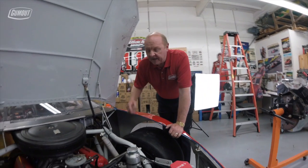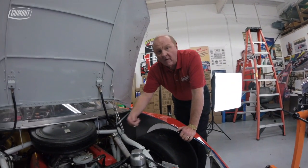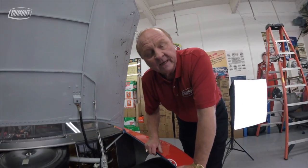What's the advantage? This crank doesn't have to turn in all that oil, just enough for lubrication. Also, in a 500-mile race you may burn three to four quarts of oil — with a wet sump you wouldn't have any oil left.